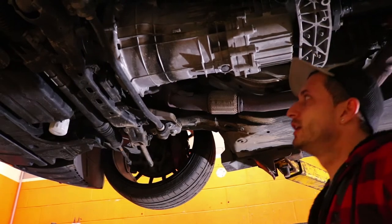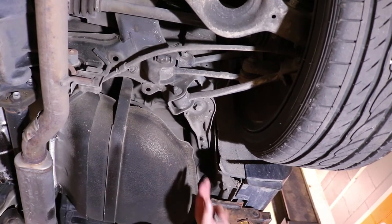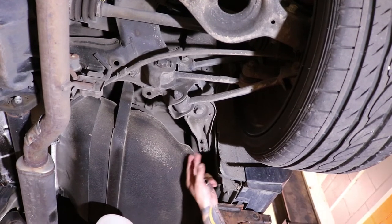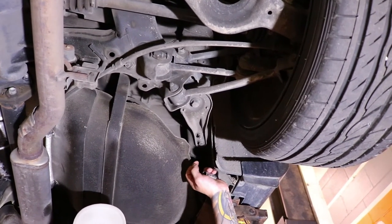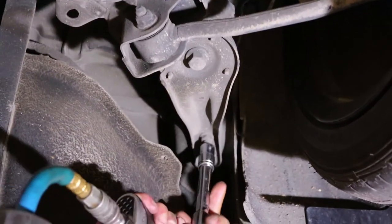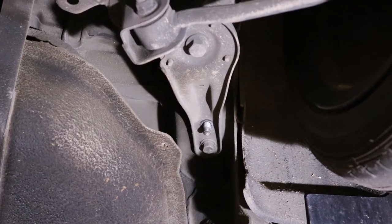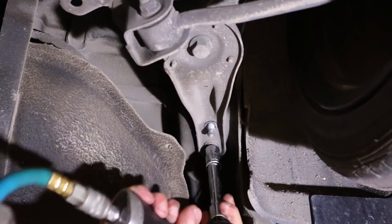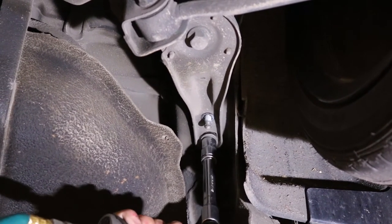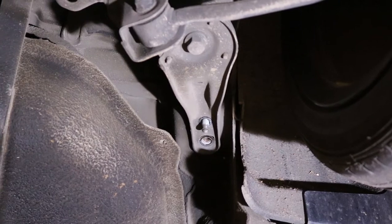That's it for the front — once those are torqued you're ready to move on to the back. Now I'm going to take the 14mm half-inch socket and half-inch extension on the impact gun and loosen off the nut and bolt on the back side for one of the rear subframe collars. Do this on both sides right away. When you go to put the back on, do not use an impact gun — do it by hand, because you'll end up breaking the stud. I did it the first time and had huge regrets.